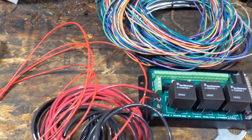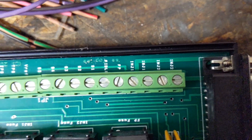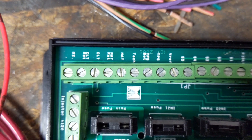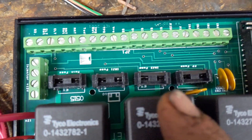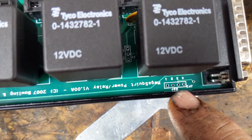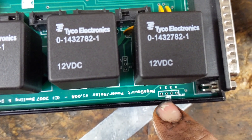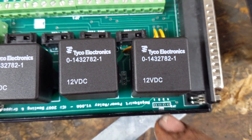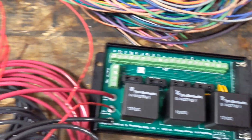Power and ground switched. These relay boards have everything laid out — 12 volt power, fuses, 40 amp relays. I think this section is for spare connectors for the CAN bus, and connectors 3 and 4 — one of those I'll have to use for a second wideband.